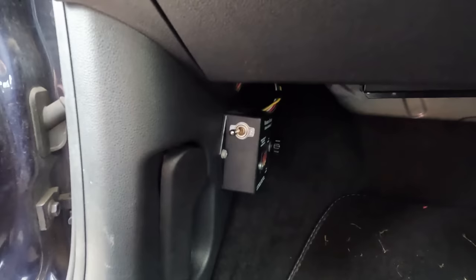When we got back, I checked the brake lights on the car and they were all right, and the brake lights on the van were all right too. So I knew it wasn't the actual lights themselves. There could really only be something wrong with either the unit in the car that does the braking, or the duo sensor unit — that detects when the brake lights are applied and when the car is decelerating or slowing down.